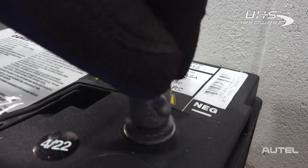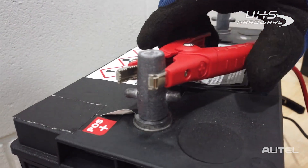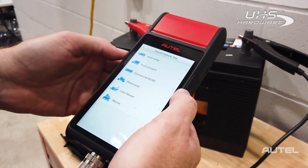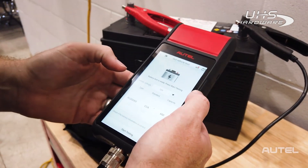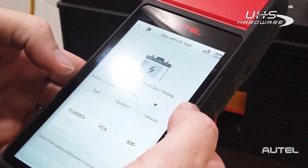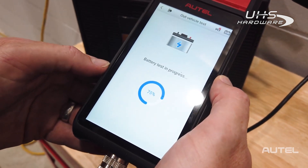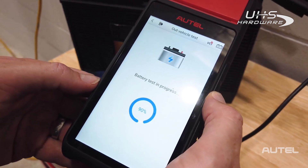On these batteries, the steel studs are there for no other purpose than to secure vehicle cable terminal ends to the lead pads. To avoid compromised readings and low CCA numbers, we supply lead adapters. Often, techs don't have the time to disconnect the batteries, but most heavy-duty vehicles use four Group 31s wired in parallel, which is a configuration that won't help you identify a single bad battery in the group, so disconnecting them becomes essential.